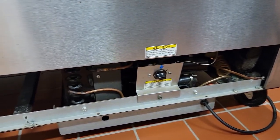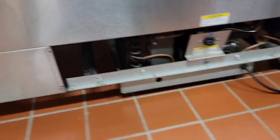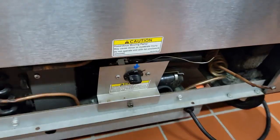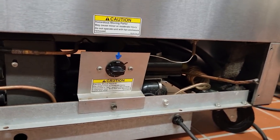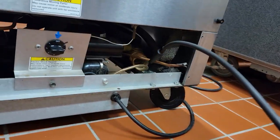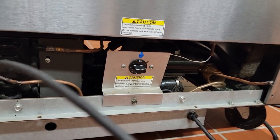On our next one here we got a milk reach-in cooler that I changed a thermostat a couple months ago. School's starting back up and it's not running - they said it didn't get cold at all. First thing I want to do is check and see whether anything is warm. I already checked and I didn't have any heat coming off the hot gas discharge. I have a feeling it's either not pumping or it's got a leak. I want to do a quick check to see if we get anything noticeable before I tap into it and possibly contaminate the area.